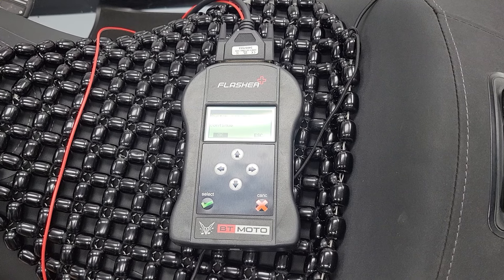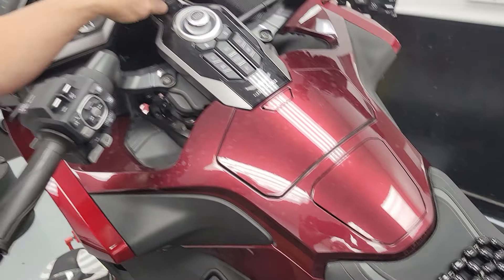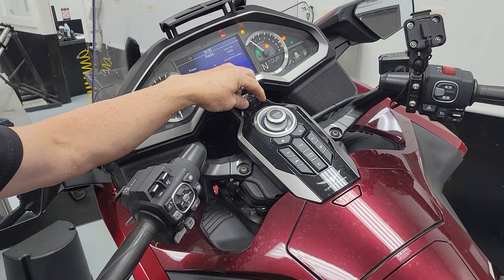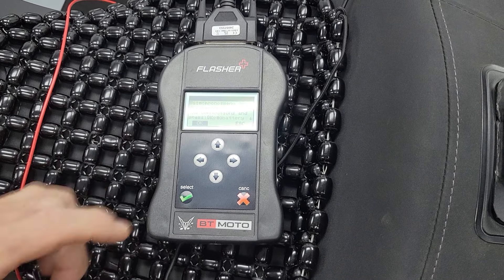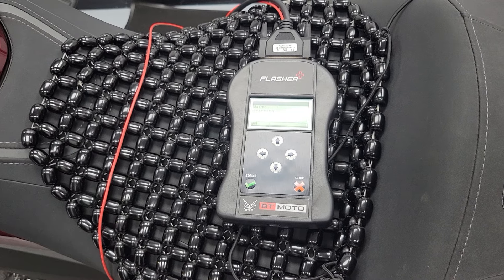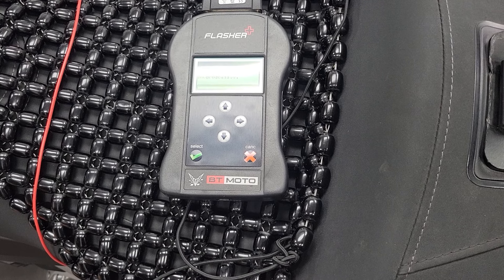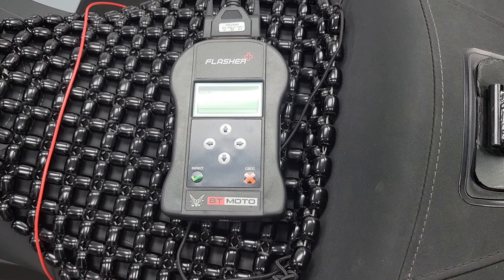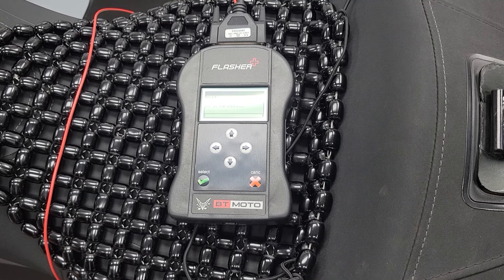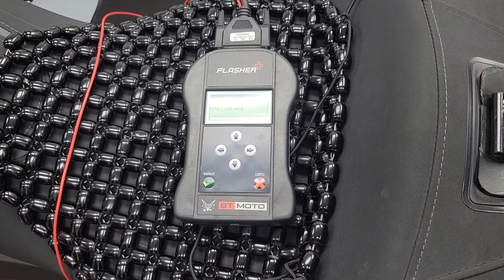Switch the onboard dash off. From this point forward, when you turn the bike off, hold this knob until the bike turns off — all the way. We're going to do that the whole time we're uploading. You're trained to just flick that knob off, but that can cause this to malfunction. It's in the written instructions but I'm warning you in advance: be super conscious of what you're doing here. Turn that knob and hold it until the motorcycle turns off.